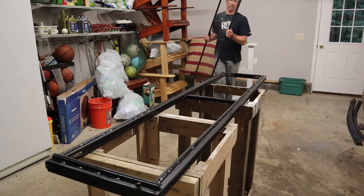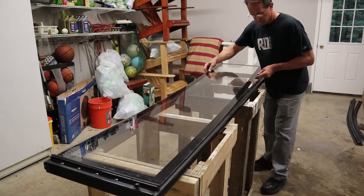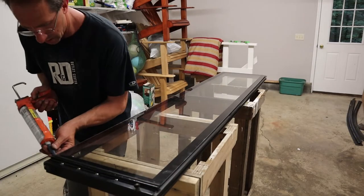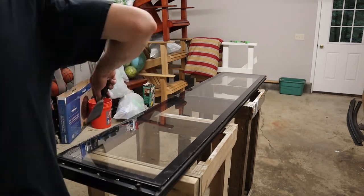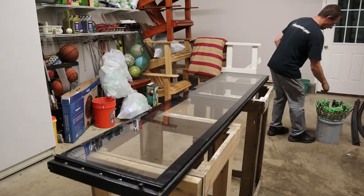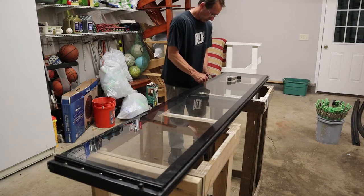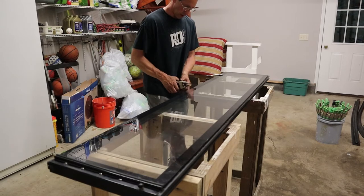You're probably wondering where I purchased the glass for the door. I originally started looking at glass shops, but their price was a little too high and they had to hunt it out anyway. I realized that on the inside of the driver's door there was the listing of the manufacturer. So I called them and they said they could sell it to me. It cost about $200 and that included some of the molding. Once the window was installed, I used some clamps to hold it in place until the adhesive dried, which also let the adhesive push out the side so I could cut it off later.